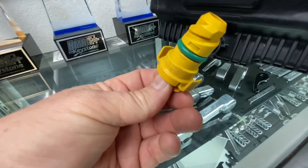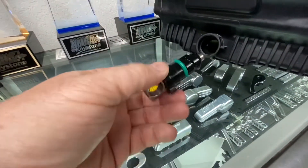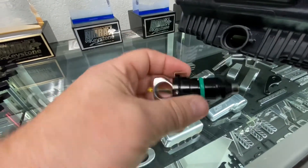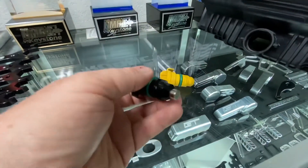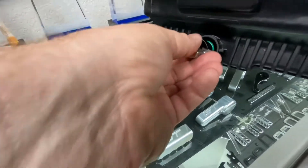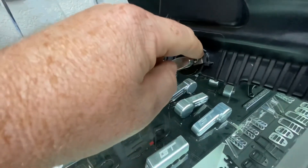Over time it's just not a great option. The UPR billet oil drain plug is machined from 6061 billet with a high quality coating — anodizing that's basically going to last for life. It's got the magnet embedded in it. Part number 302501, it installs just like the stock plug but goes into the factory grooves.